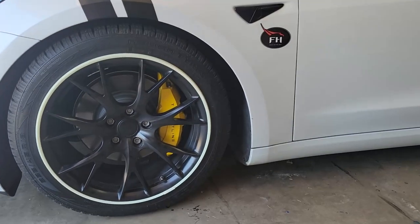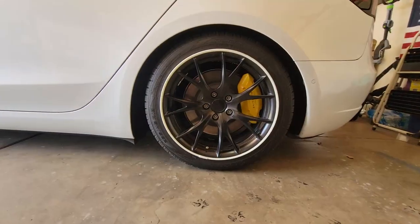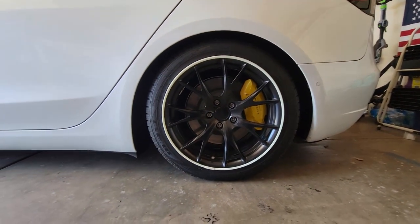Well, you want to remind yourself how out of shape you are — pull four tires, jack it up, put all those on. Oh my God, I am definitely out of shape. I also need to take a shower from rolling around on the ground. These look amazing — the fit and finish on these was absolutely fantastic. I really like the way they make the car pop just a little bit more. I'm going to go take a shower, drive this around for a minute, then bring it back and re-tighten all the lugs — 129 foot-pounds, I believe; mine are set for 130. Whenever you change tires or anything like that, always come back about a hundred miles later and put your torque wrench to them just to make damn sure everything's good to go.